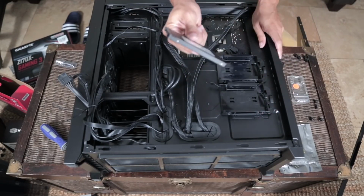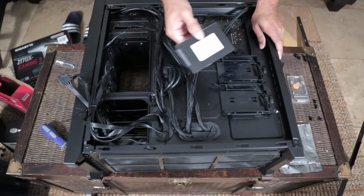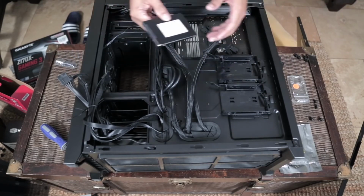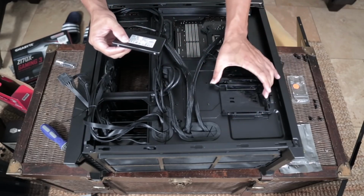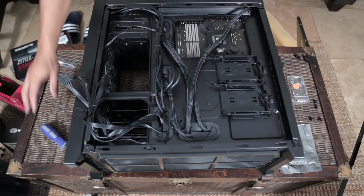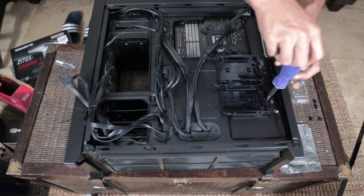And what we're going to do now is get the right screws. They should come with your case or solid state drive. I'm going to have to go find some because, like I said, all my stuff's secondhand. And you'll screw them into this little bracket. Let's see if I can get this out. Oh, you've got to unscrew them. Jeez. Not all cases have similar SSD mounting brackets.